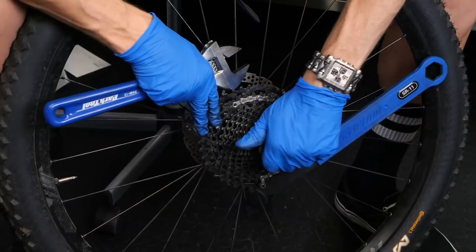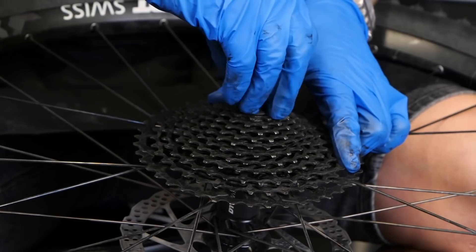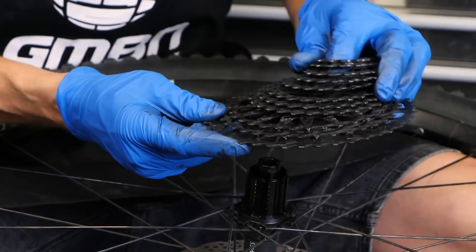If you're out on the trail without a chain whip, you've got to hack it. If you're at home and don't want to buy one — they're not expensive, probably seven or eight bucks for a cheap one, twenty bucks for a decent one — you could make one using an old chain and a thin metal bar. Drill three holes through, attach the shorter bit and the longer whipping bit using a chain tool through the rivets, wrap the handle in bar tape. You could make one at home quite easily. Anyone else got hacks for getting a cassette off? It's one of the few parts that needs a very specific tool.